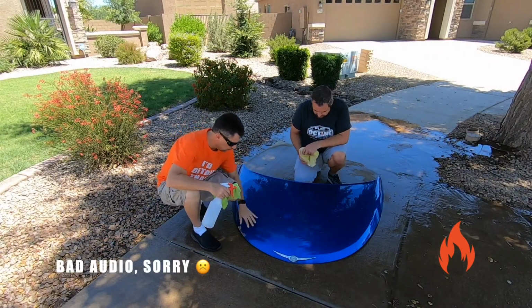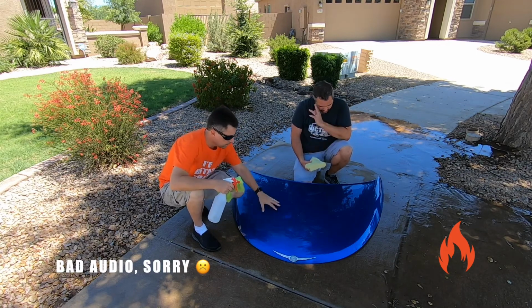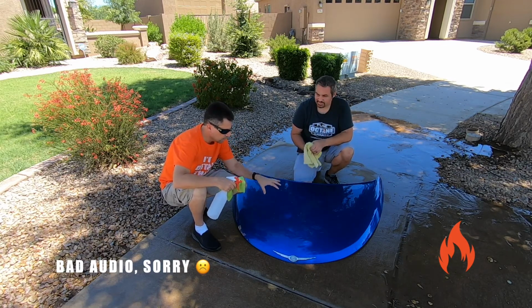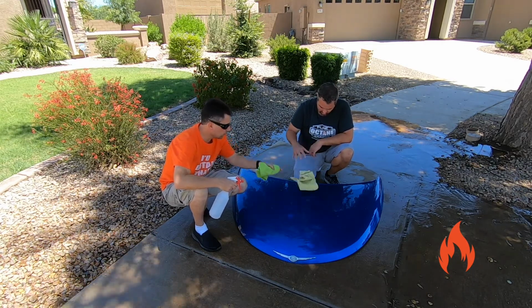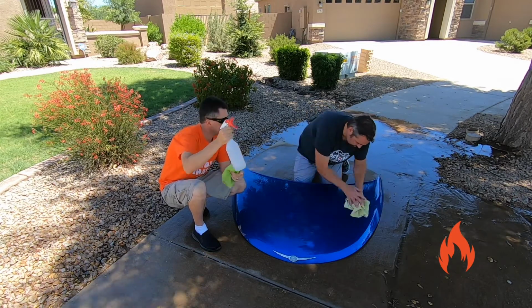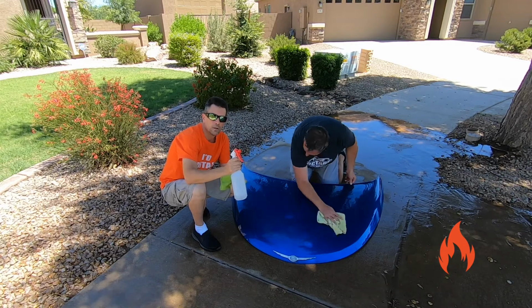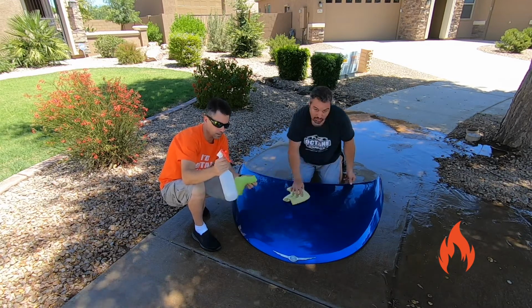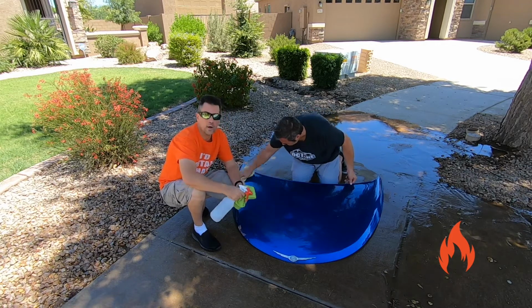Now the water is sheeting. There's no product protection on here. The final step is we'll dry it up, and then wipe it down with 50-50 isopropyl alcohol, the 70%. You can use whichever you want. We do a final wipe down, and then the hood is now ready.